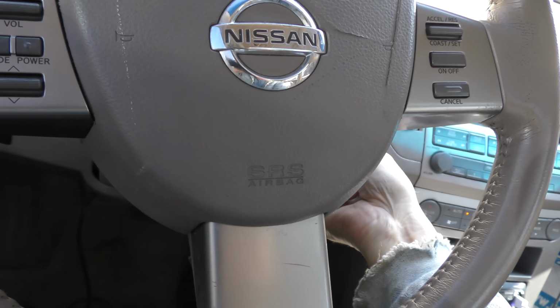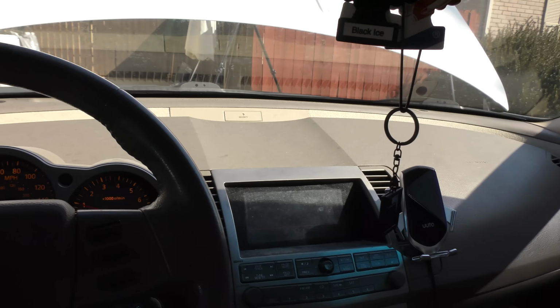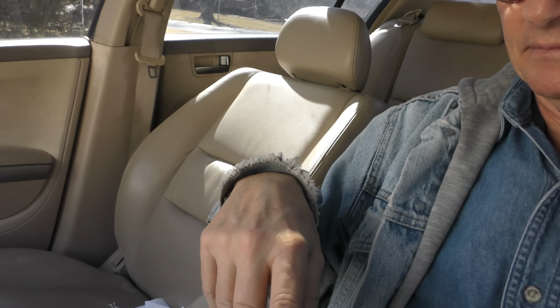As we can see here, it starts right up, isn't particularly shaking, it runs good enough. Now as you rev the engine up, you can hear a little popping because of the cold air intake and the exhaust change. Listen. You can hear a little popping. Hear the pop, pop, pop. That needs to be set first before you start changing sensors on this car.